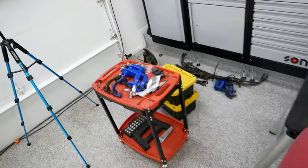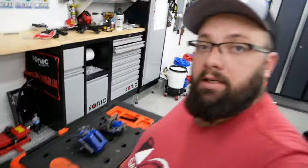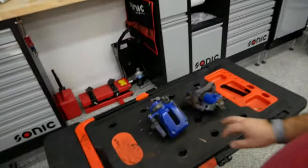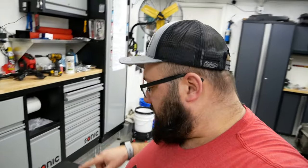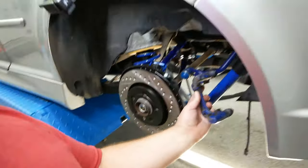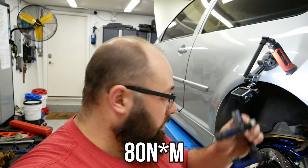There you have it. I now have three sets of rear calipers to make one working set. Obviously these will work fine, but I have new ones, so what I'm going to do is take these caliper carriers off. The caliper carrier goes right in here. These are torqued down to 80 newton meters — so if you want to know the specs, 80 newton meters.